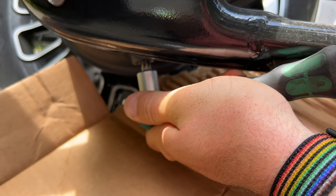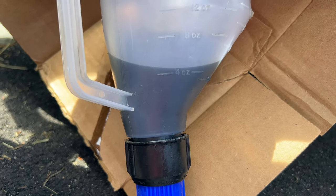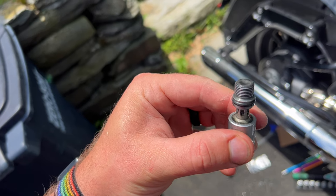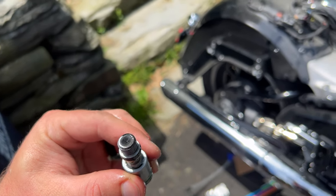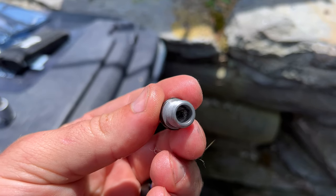On the bottom we have our T45 — take this out and drain roughly 210 milliliters of fluid into a vessel of your choice. Because of the tight quarters I ended up using a funnel with a stopper on the bottom. I replace the o-ring because it's cheap insurance. You'll notice this is a magnetic drain plug, so you need to clear out all the gunk. I used a few pieces of napkin and got it all cleared out, then attached my new o-ring.